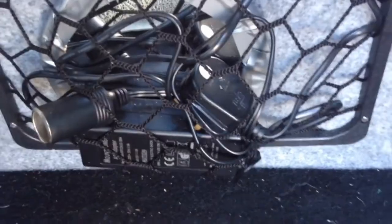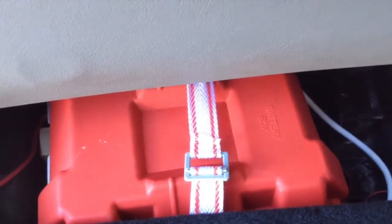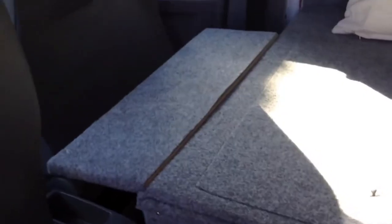However, for weekend use only, you could plug it in at home and get it down to temperature before your trip. I used a split charge relay from the starter battery to the 86 amp leisure battery. I found this was fine for charging my phone, USB speakers and powering the lighting etc.